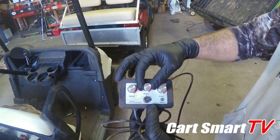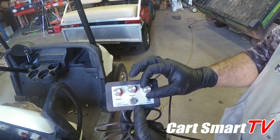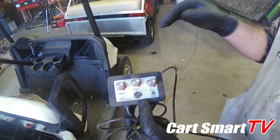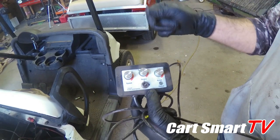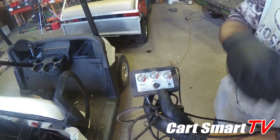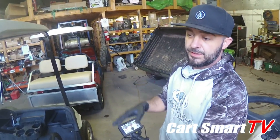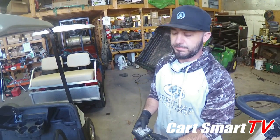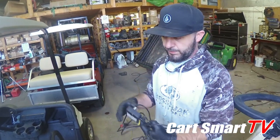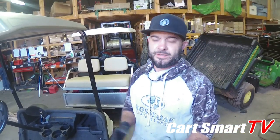This is your regenerative braking - you can turn it all the way up and it'll brake like nobody's business, or turn it all the way off and give the cart more acceleration. While you ride, you stop, change it, cut the key off and back on - it changes it in the controller and then you go on again. This capability is also linked with your cell phone app too, so you can do everything with the on-the-fly knobs in the app as well - it just takes a little more time. However you want to do it, both options are available.